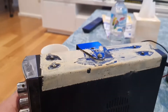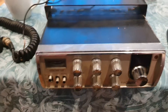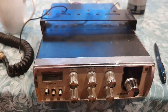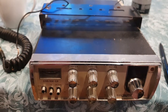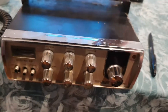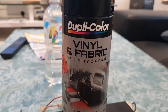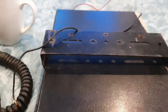I'm going to attempt a few ways of getting this off — the first one is mineral turpentine, which I've used in the past. We're going to prep this and show a video on painting the vinyl covered surface. The process is: first clean and remove the adhesive residue, then bathe it in a 50/50 commercial workshop degreaser, then hit it with wax and grease remover, and then try a new product — the Duplicolor vinyl spray.